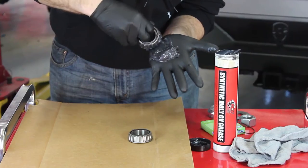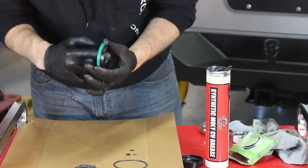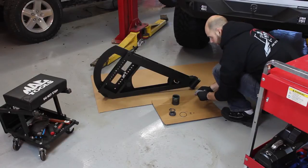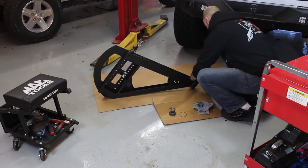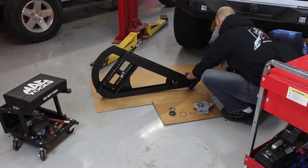Pack the bearings with some grease, working the bearing around in your hand and kneading the grease into each of the bearings. Apply a little bit of grease on the inside of the oil seal as well as the top cap O-ring. Prop the carrier so you can install the lower bearing — place the lower bearing taper side down into the carrier. Using a large socket or punch, knock in the lower oil seal. Make sure you hammer in carefully and most importantly straight.